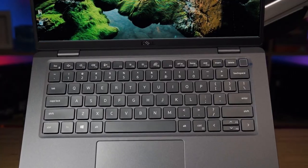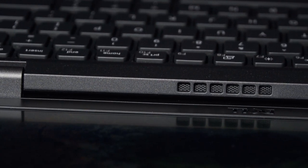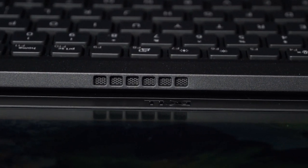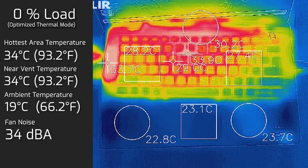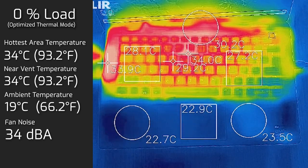For temperatures and fan noise of the Dell Latitude 7320: under load, most heat was concentrated near the top center of the keyboard, specifically around the Y and U keys — unsurprising as that's where the processor sits. There's also some heat near the bottom right where the SSD is located under heavy drive use, but it remains very touchable. My ambient temperature was 19°C. At idle, the hottest keyboard area was 34°C and fan noise hit a maximum of 34 decibels.